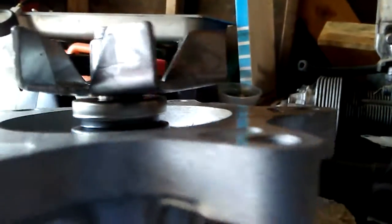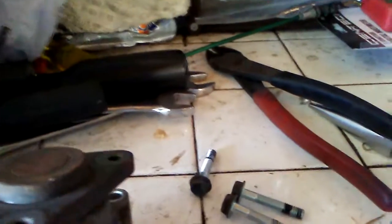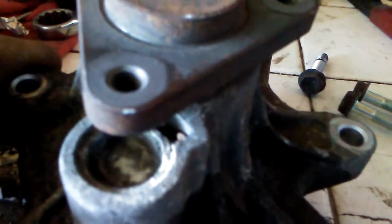Just to give you a glance of what it is inside the water pump — this one is a lot more straight. And then you can see down here on the bottom, it was leaking. There's your teardrop hole — what you read on the internet. That's your teardrop hole on the bottom for the freeze plug, and that's your one on the top. It wasn't the top one that was leaking, it was that one. You can see how it pulls up at the bottom — it'll just drip right off.